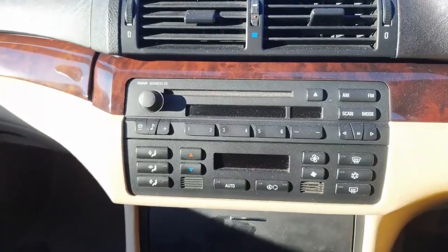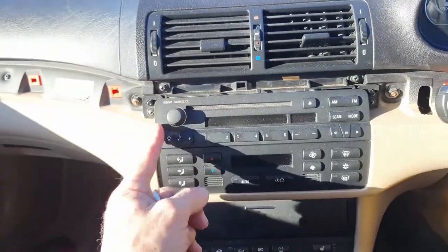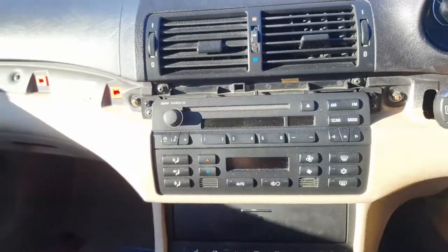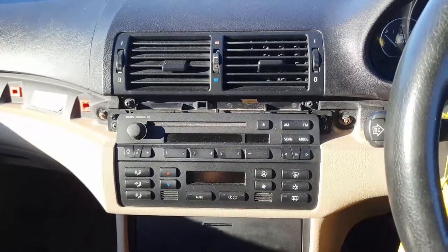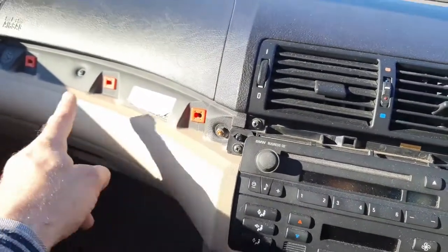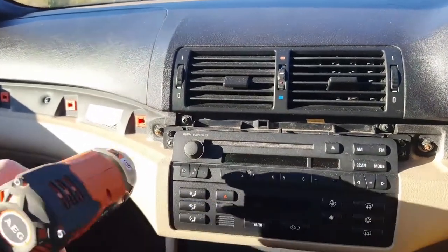The trim's removed. Just make sure you start with this side first before you remove the other one, because this left-hand side piece just covers the little end piece. So remove the left-hand side piece of trim first, and then the other one comes off. It's a little bit tough — give it a pull, don't be too afraid. Make sure the little red inserts stay back in the console of the car. Now we can get to the Phillips screws.